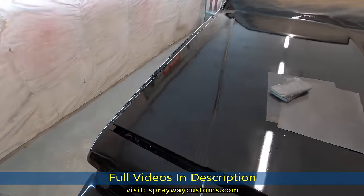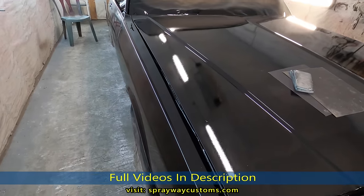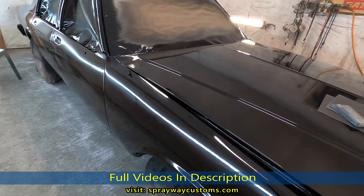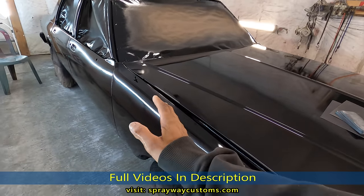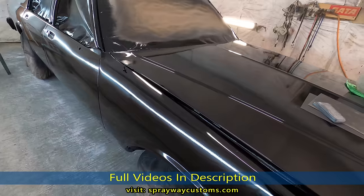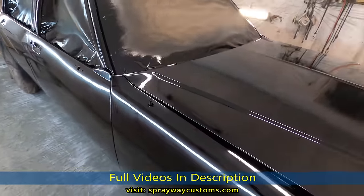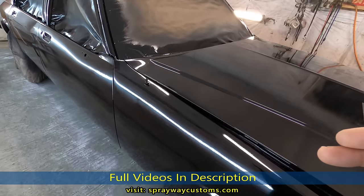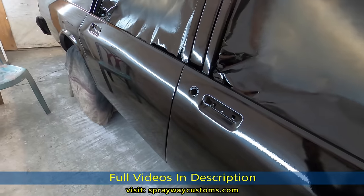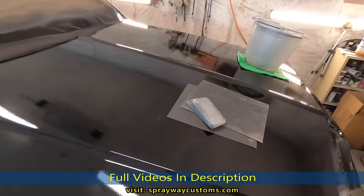And then some folks be asking me why I just don't put six coats of clear from the jump on here. Because after all the coats I done sprayed, the orange peel just keep building up. So what I'm gonna do, I'm finna sand all this flat and start off fresh. So that means I just got three coats' chances of getting orange peel. From the jump, I sprayed a coat of sealer, two coats of base, then three coats of clear. That's like six coats. So the orange peel had built up. But we finna sand it down.